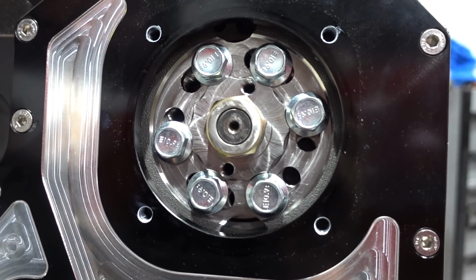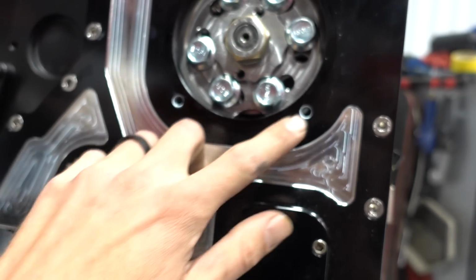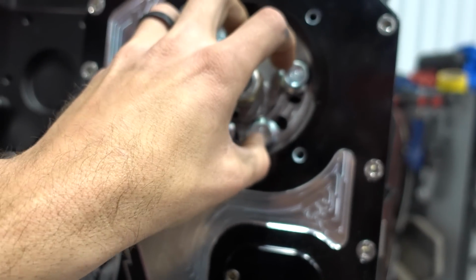Or maybe I've got a higher pop pressure injector that I went from 260 to 300 bar, and so I've got a little bit of latency in the timing, and I want to get it back to where it was, so I'll advance that 2 or 3 degrees to make up for that. Either way, this gives you the opportunity to take care of a bunch of issues at one time, and conveniently, this King Speed cover allows you to get here and access this. That's why this has this access window, is for this specific application. So if you're thinking about buying one of these, and you've got a P-pump truck that makes any power at all, or you're in a quest for making some power on a P-pump truck, buy an adjustable gear, put the Woodruff in, get it timed up, set your stuff, and know that you have adjustments one way or the other so you can dial in your application.